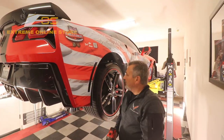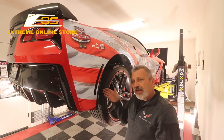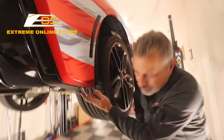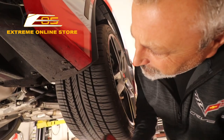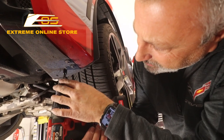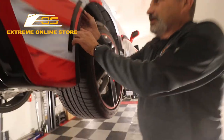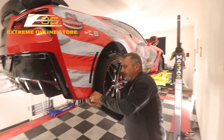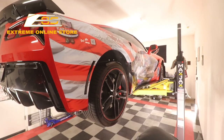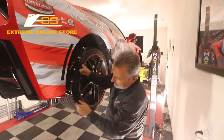On the back we're going to do basically the same thing we did on the front side, except the rear ones don't have that little tab we were talking about, so this one's actually a little bit easier. There are actually three screws underneath here, but all we're going to do is loosen these two — we don't have to take those out — but we're going to take this one right here out. So we'll take that out and then just pull this loose.